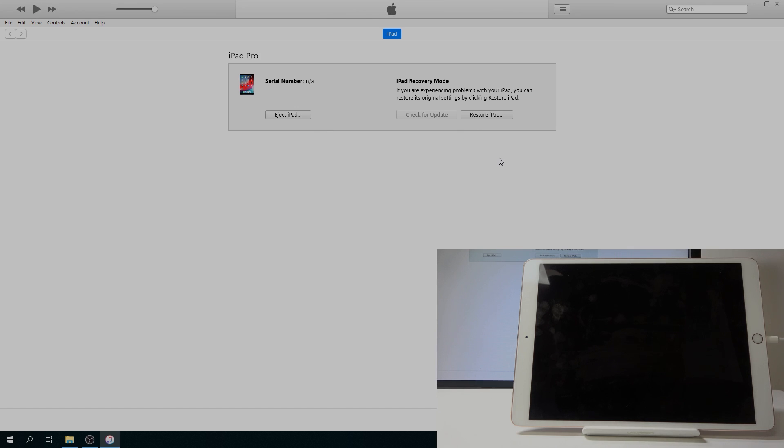As I mentioned, the difference if your device is off when you hold the buttons is that it will show a white screen as if it's turning on with the Apple logo, and then soon after that will disappear. The result is basically the same. From here, all you need to do is tap 'Restore iPad'.